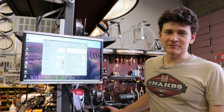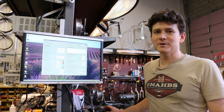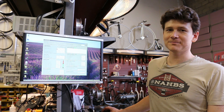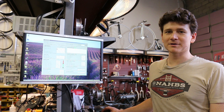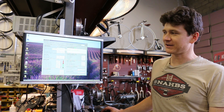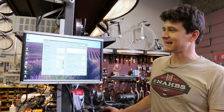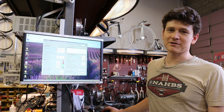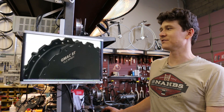If you've got the GMAC motor and the PhaseRunner together as a kit from us, we'll have pre-loaded a set of settings on the PhaseRunner so you don't need to do any tuning — it will come pre-tuned. If you're hooking it up to a controller you got previously, you need to make sure your motor parameters are configured correctly. The GMAC motor has 80 effective pole pairs — it's a 16-pole motor with a 5-to-1 gear reduction ratio — and the RPM per volt is 8 or 10 depending on whether you have the 10-turn or 8-turn winding.